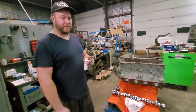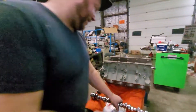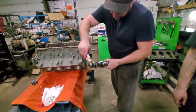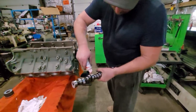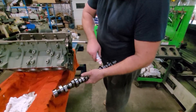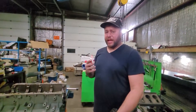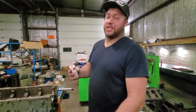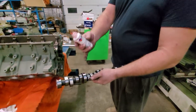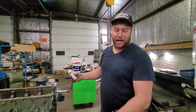On everything except for piston rings - do not put it on your rings. Use engine oil, we'll get to that part of the video later. Be liberal with it on surfaces. You don't need to do the cam lobes. The only thing is if you're running a flat tappet cam, yes, you have to lube your lobes, but that's a completely different process we'll cover in another video. These ones here, I would normally lube them heavier than this, but we're just doing a test fit. I don't want all that lube loose in the engine when we flip it back over.